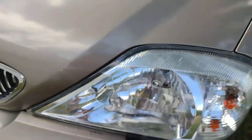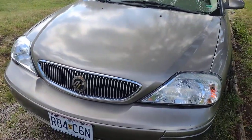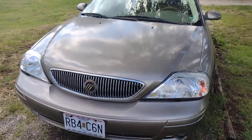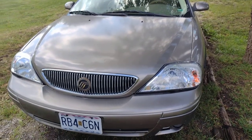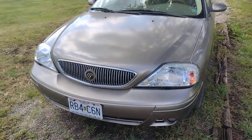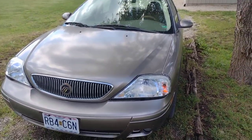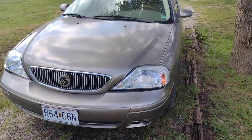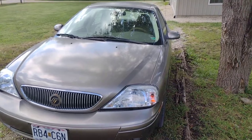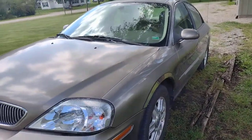There's no point in showing you under the hood, but it's not really needed anything under the hood other than changing the oil in it once last year. It's not due yet, it's not dirty enough. And a new AC compressor which happened about a month ago, and a new serpentine belt because the bearing on the compressor clutch seized up and snapped my old serpentine belt off.